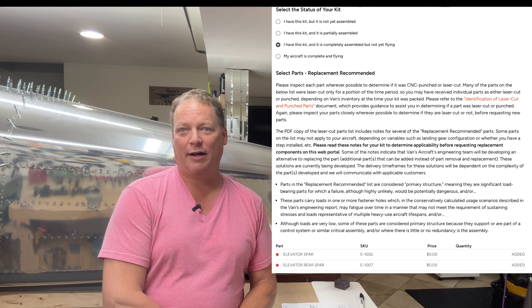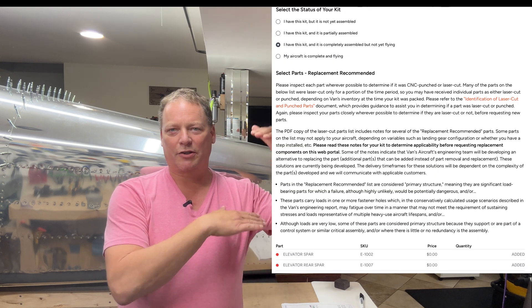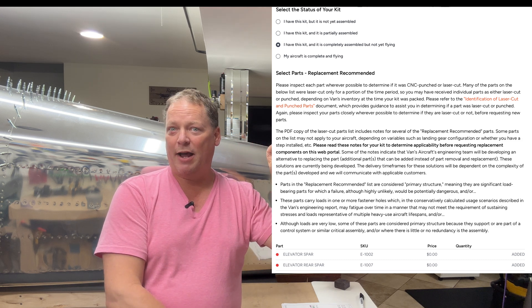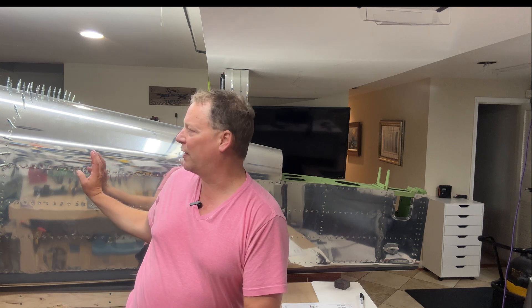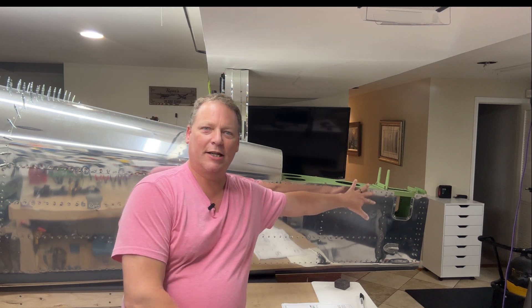So this morning I was pretty ready to do the ordering process — I'd already created a spreadsheet of all the parts I needed. What I appreciate on their new portal is how easy it was. It allowed me to just pick my empennage kit off the list, then it broke the parts by severity and color. The reds were all on the top, showing the maximum number you could buy for your kit. I picked the maximum quantity for every one of the reds and hit add to cart. For the blue section, I'm not going to replace all of the blue — I found no issues with the ribs going forward in my empennage, for now. As I tear this part apart and start really inspecting those holes that already have the rivets in them, I'll make another decision. Maybe I'll have to go buy some more ribs and tear into this more than I thought.